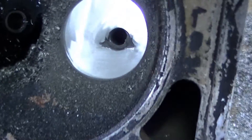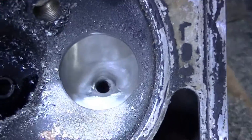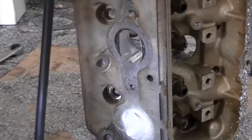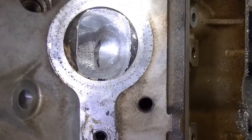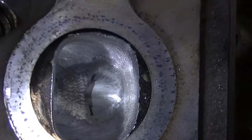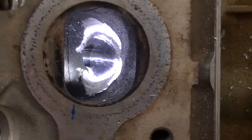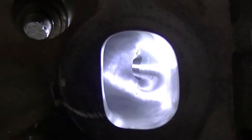And guess what guys, that port's done! You'll see how pretty that sucker is — the light reflects off of it, it's nice and smooth. Here's a nice and beautiful port compared to that guy over there — you can see all the metal imperfections in the unfinished one. That one kind of looks like a CNC'd port. There's the top one, and look at the bottom one — see how rough that is — and then we have our beautiful finished port guys. Nice, thanks for watching — we'll get to the intake ports next.